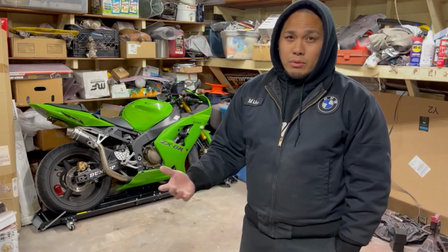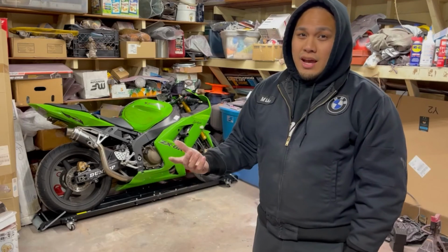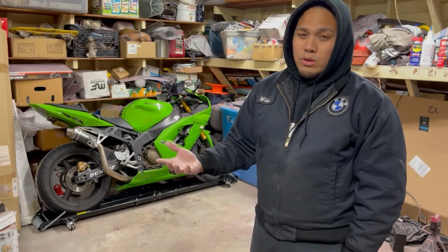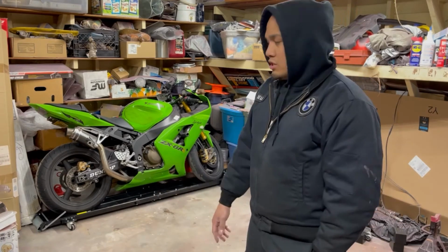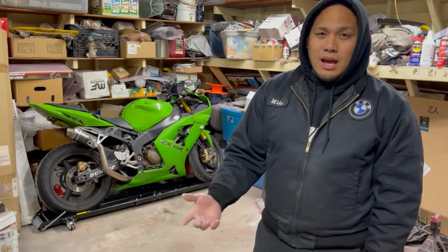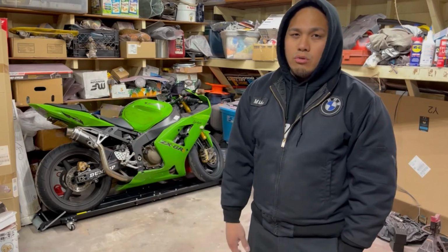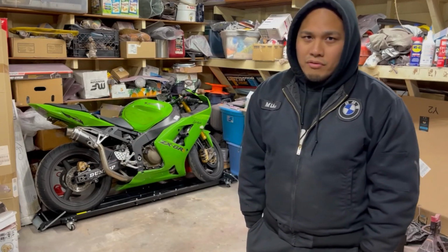It's a little trick that we do at the dealership. So I go ahead and overinflate the tires over spec so that you can actually park the tire in one spot for a longer amount of time to prevent flat spotting. Just remember that in the summertime or when springtime riding season comes around, just remember to adjust your tire pressures accordingly to your spec or to your riding preference that you're doing.